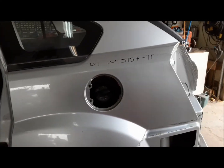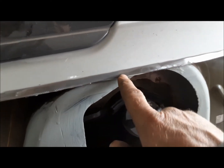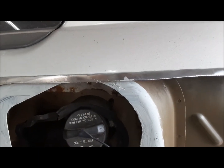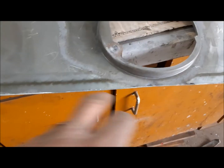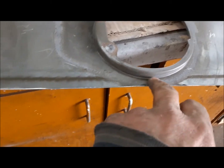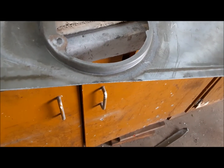There she is sat in place - it looks better already. Now I'm going to do some thinking about what I'm going to do across the top here. Because of this, I had to cut this panel up a little higher than the other one. So what I'm going to do is nip the other panel off about here and flange it so it goes under this one. It's not the most ideal way to do it, but that's the way we're going to have to do it on this side. I've got our flange across - now you can see right around here the top of the gas door, I can't really get it flanged, but that's okay. We can do a little work in there with some filler and it should be okay. Now all I have to do is knock back the door jamb a little bit on the body like we did on this side and this panel should fit on perfectly.